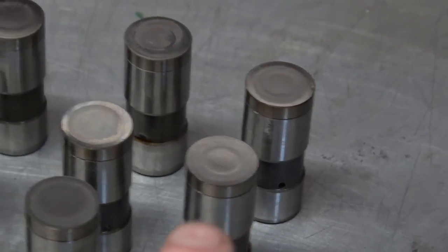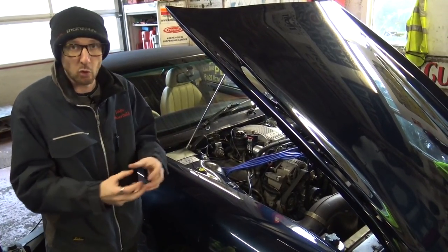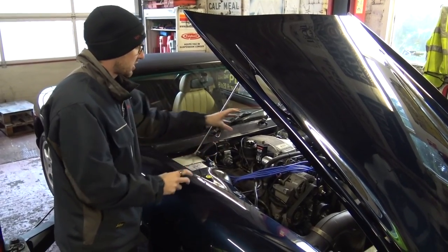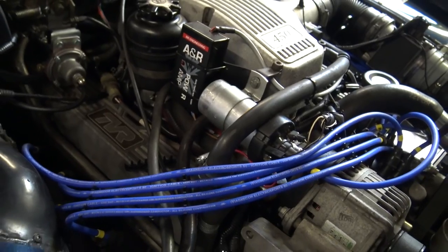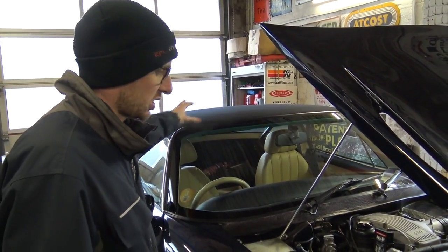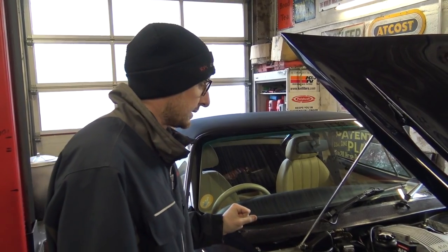You can see where that wear had started. Ideal time to replace the camshaft because it means any swarf material that had started to get around the engine has now been flushed and washed out, and we've removed the cause of that swarf. So we've got a fresh 285 camshaft in there, brand new timing chain set, OEM lifters, tappet preload has been set, and then the RPI ignition kit - the amplifier, MagnaCore plug leads. The customer already had a relatively brand new Bosch coil - no need to replace it. The correct non-resistive spark plugs are in there with our cap and rotor setup, and obviously the Tornado ECU chip as well. The car drives really smoothly. There's a little bit of a knock on the back end which we're discussing with the customer - we think it's the diff itself.